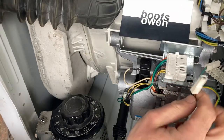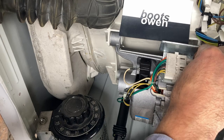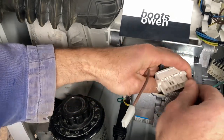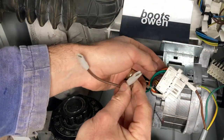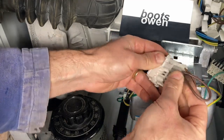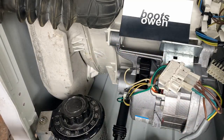What we need to do is take the power from the mains and put it into a brush. I guess the orange wire is a brush — that's guess number one. On number one, put one side of a brush and put the mains coming in. Then take a jumper cable with a spade connector on each end and jump from the other brush to one of the coils — just put it onto any one. Then take the mains out, and since there's no in and out with alternating current, take that back to the mains. Now we're wired up.